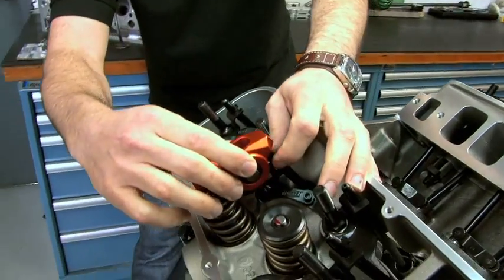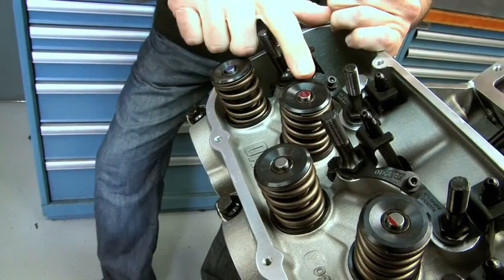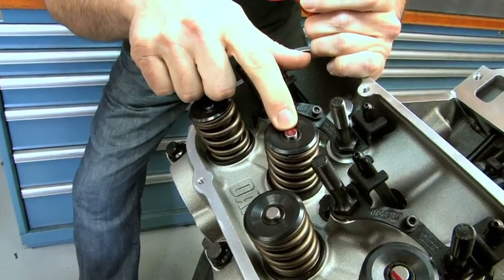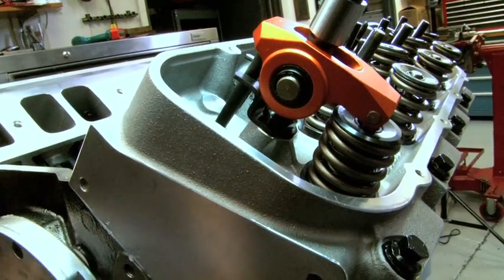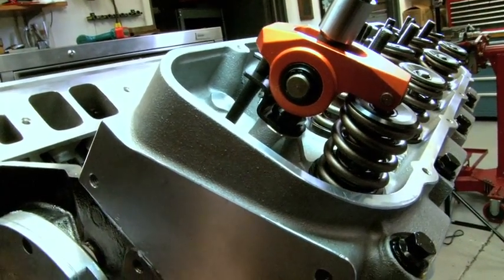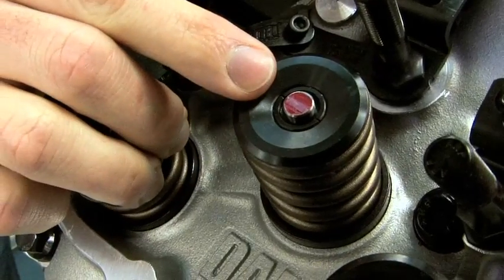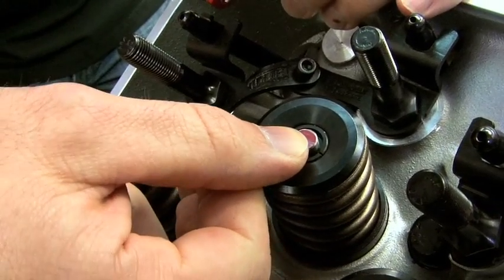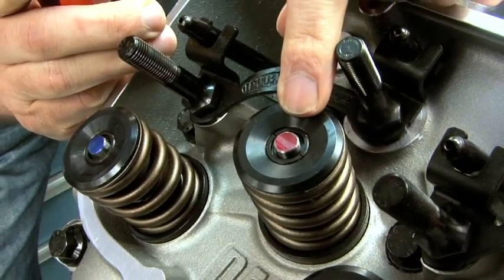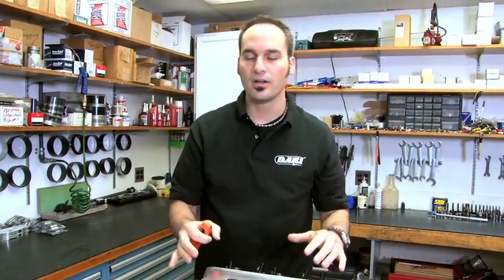I also want to make sure that I've got my load pattern right about on the center of the valve as I sweep through its motion. A couple ways you can do that — you can put some magic marker, maybe some blueing, coat the tip, and put everything together. Rotate the engine through a full cycle, and that arm's going to sweep across that valve. Once I pull everything apart, I can look at the tip and see what my travel point is. If I'm a little too far towards the edge, I can shorten my pushrod to move the pattern the other way. If I'm too short, I lengthen my pushrod and move it towards the outside. That's going to make sure everything gets loaded properly, I make all the power I want, my valve train components are going to last for a long time, and I'm going to go out there and have a lot of fun.